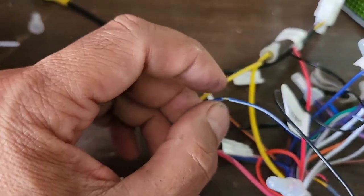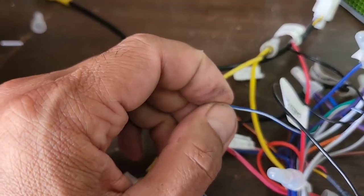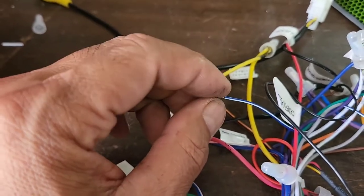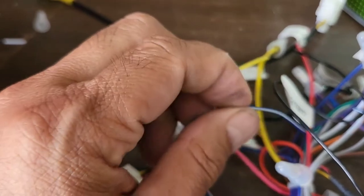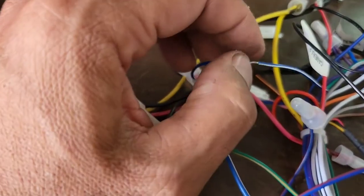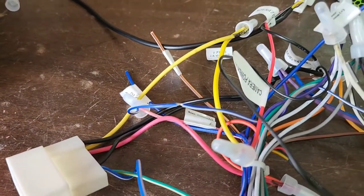In this case, we're gonna have to run this wire for this Hyundai to the backup 12 volt. There should be a 12 volt on the fuse box — I'll show you that one. The black wire you want to hook up to the ground also.